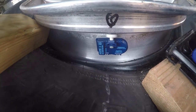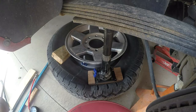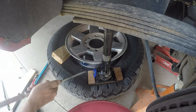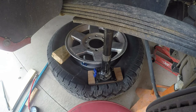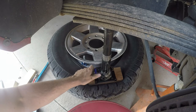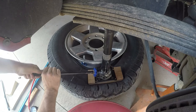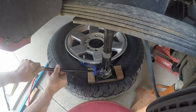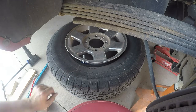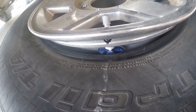As far as the size of these go, I'll compare them later on the bench — it's a little bit smaller, seems to fit maybe as flush. We're just going to blow the trash out of there. Now let's lube this up and get the bead back on, get it aired up. Got our Yamaha brand of soap.